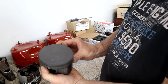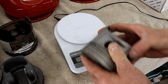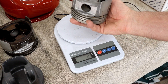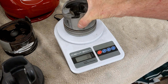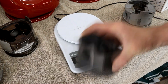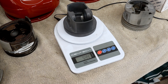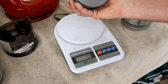Here's the digital scale. I'll reset it to zero. First, here's a standard 103 piston from a 63 set — that's 740 grams. Back to zero, and now one of the new ones — 544 grams. That's 196 grams lighter on the new pistons — a substantial amount. Times eight, that's a significant amount of weight coming off the entire reciprocating assembly.